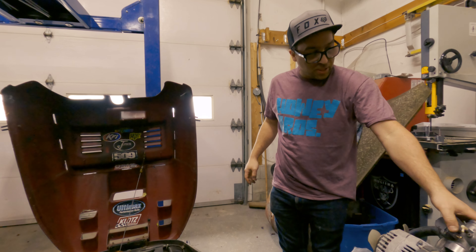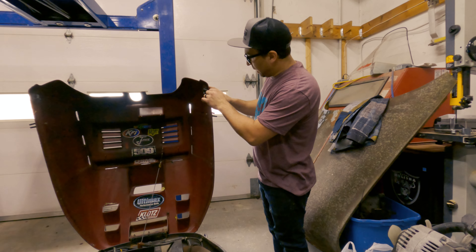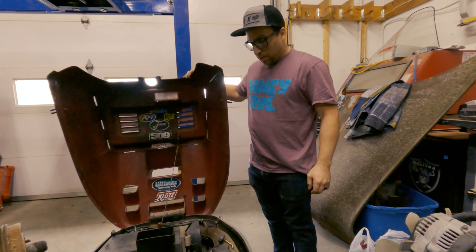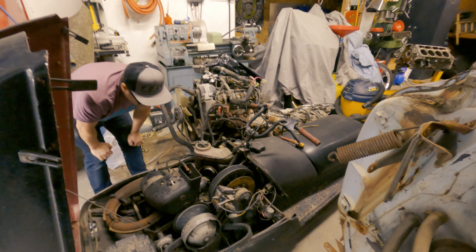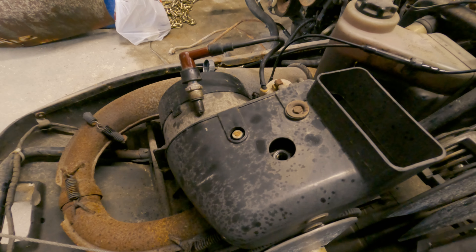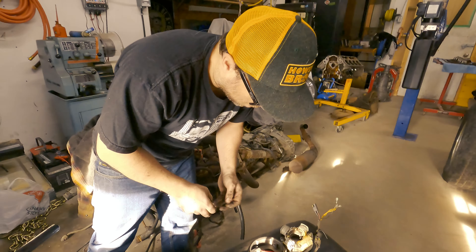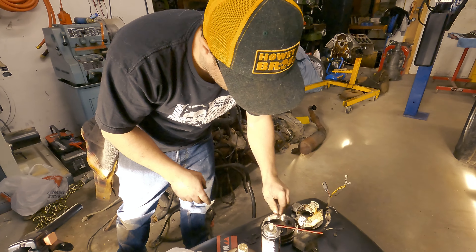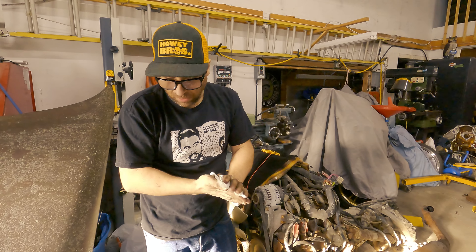This is my competition sled for this winter. We're having a little rally-like competition where we've got to drive to the end of a non-maintained road in the winter. We checked if it has spark — nada. It's a new coil, old CDI. So the old stator is off, let's go get the new one — new old one.